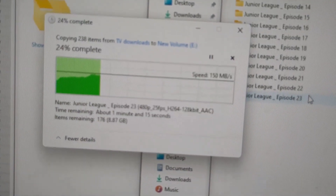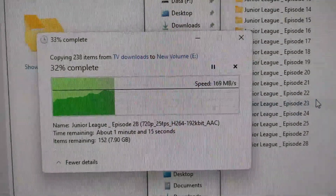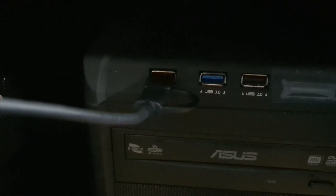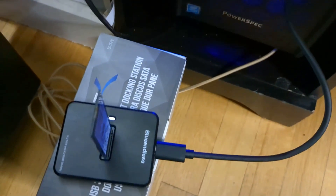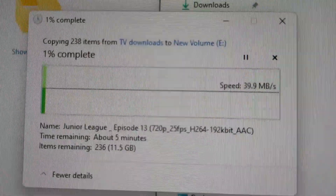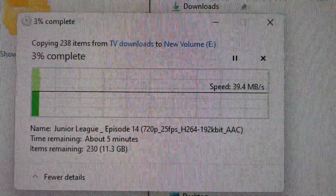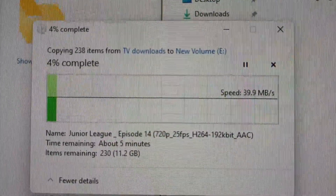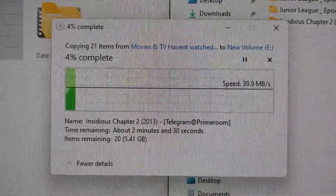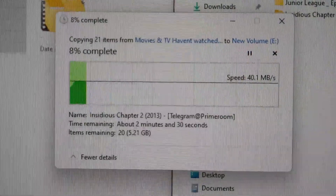The light is still blinking but it's not going nearly as fast. It is still using USB 3.0 and therefore still able to handle a significant speed using SATA, however it is bottlenecked by the hard disk drive. I am using a USB 3.0 port, but now let's try a USB 2.0 port. Using the USB 2.0 port the max speed is 39 megabytes per second, maxing at 40 — that's because of USB 2.0. So as you can see the port really makes a difference. Even copying from the SSD on my computer I'm still getting only 40 megabytes per second because of USB 2.0.